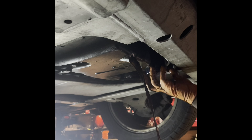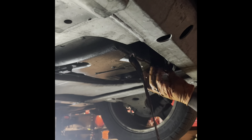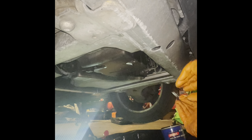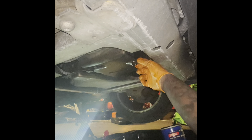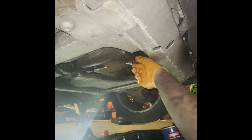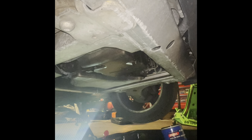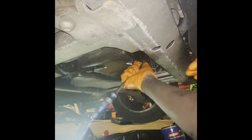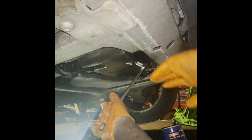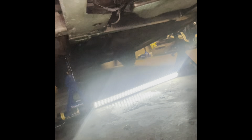As we can see, the bottom of this oil pan is pretty wet, so it seems the gasket has already started leaking — perfect time to change it. Oil is pretty much all drained out, so I'm going to go ahead and plug this back up. It doesn't need to be 100% drained because when I remove the oil pan it's going to turn upside down and drain the rest anyway. Tighten this drain plug — it doesn't have to be ridiculously tight like the previous person did, just a nice snug.